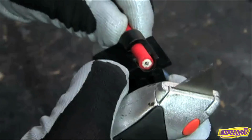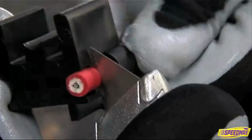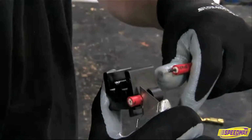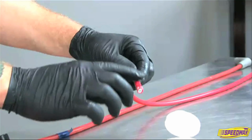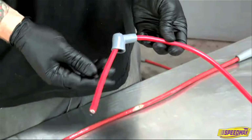With the wire end flush with the end of the tool for standard terminals, or at the dual crimp mark for dual crimp terminals, set a razor blade flush with the edge of the strip guide and rotate the wire 360 degrees. Twist the cut end of the plug wire until the sleeve pulls off. A small dab of MSD dielectric grease will ease the installation of the boot. Slide the boot 6 inches down the wire.